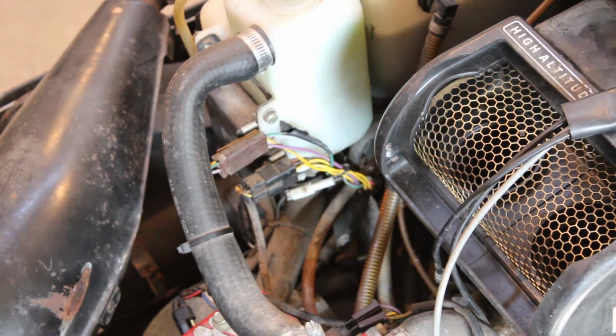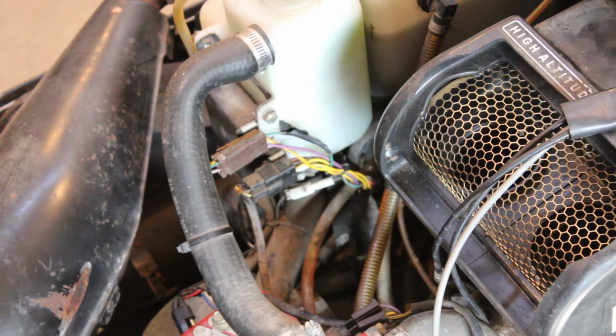We're going to go back over on that side and then just check the output on the wires that are coming from the stator. I don't unfortunately have voltages that we should be seeing there. I just want to make sure that I'm seeing something, and you know, nothing that's blatantly wrong.